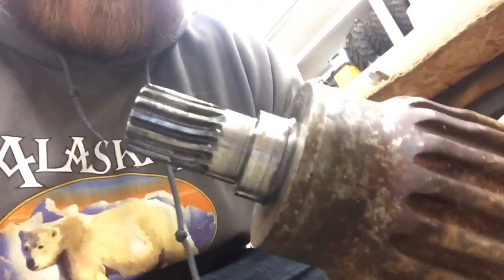I needed a drive shaft. The end of this drive shaft twisted - nothing's about to break. The 04 Pro-X2 used the big diameter drive shaft where every other Pro-X used a smaller diameter drive shaft, kind of like the older sled stuff - solid steel. This newer stuff, honestly the solid steel ones are probably stronger. These are just held on with rivets, so not super impressed.